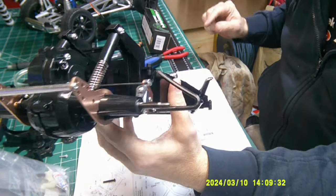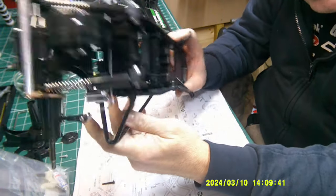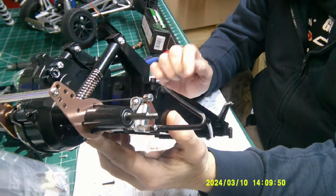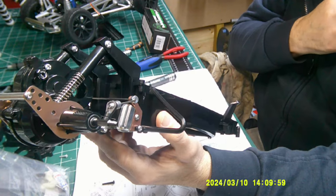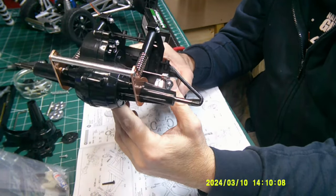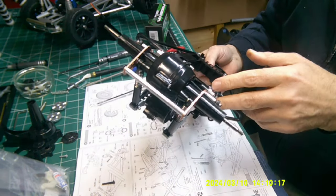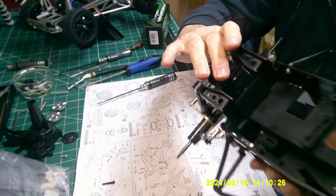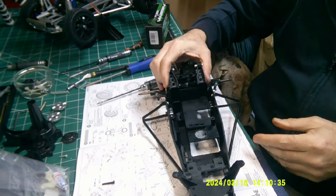I thought I could pause halfway through to show you the anti-roll bar — that only fits the standard grasshopper, not the new rear axle gearbox assembly. It bolts straight on, dead easy, didn't have any instructions with it but didn't really need them. I can't really go much further other than put the rear wheels on, so I'm using these aluminium billet hubs — not hexes. It's gone together really nicely. I put marine grease in the back friction shocks.